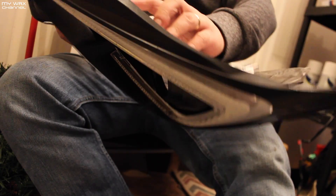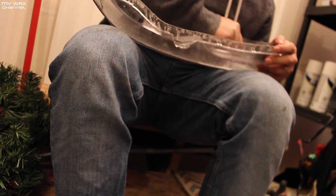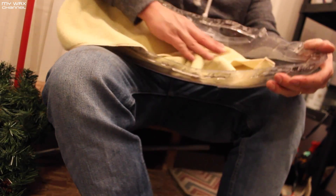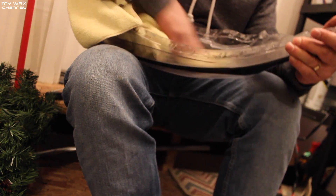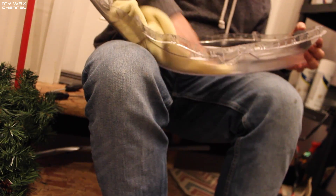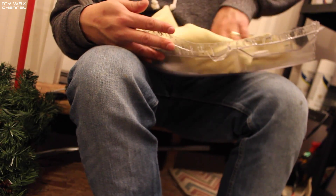There's the inside part. And the outer lens, which I'm going to clean. I'm just getting a clay bar — just getting all that dried-up condensation that's in there. I can see some clear glue in there. I applied a little bit of polish on the inside because the clay bar left some fine scratching, but no big deal. Looks like the polish is taking it all out — it's going to be crystal clear. The hardest part about this job is making sure there are no streaks and the glass is clean before you put everything back together.